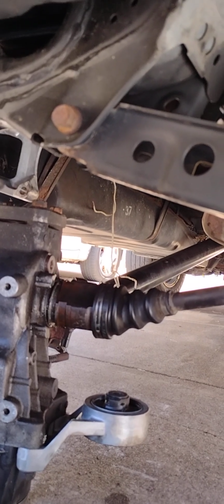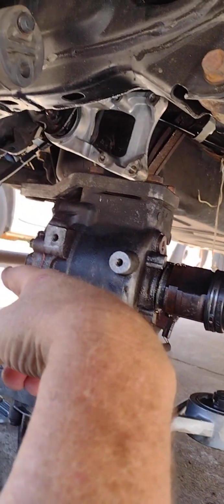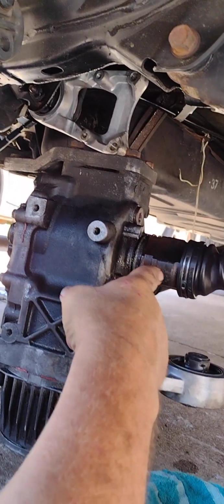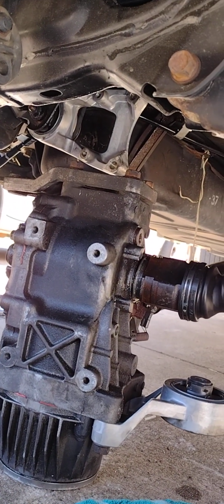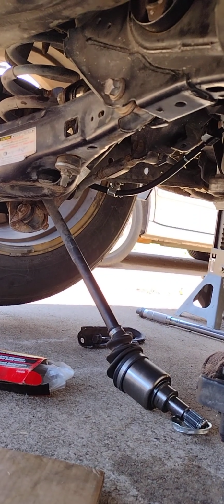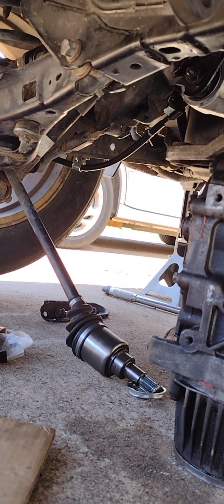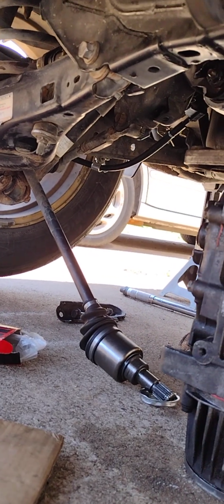What I'm going to have to do is remove the passenger side rear wheel and take the axle out with the transaxle, since that's probably not going to come out undamaged. And I'll have to replace the axle and the transaxle. The driver's side axle I think is okay. The dust cover thingy got damaged. I can replace that, or just leave it off. I don't think it matters.